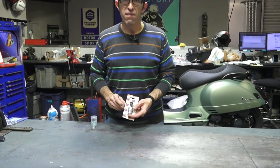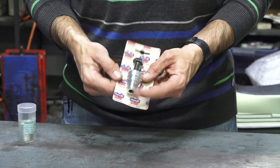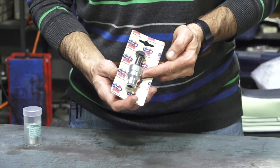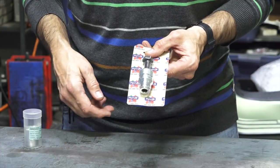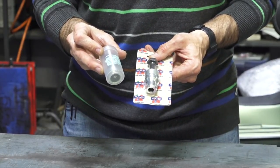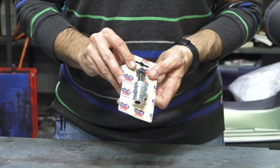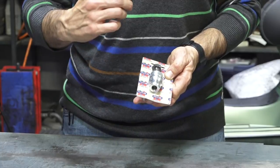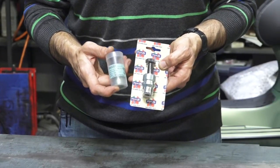This is a quintessential tool if you need to remove the flywheel to gain access to the points on a P series Vespa. Pretty much any Vespa manufactured after 1978 would use this style puller — that includes the ET3 small frame, any of the P range Vespas. Part number is Tool Fly. Sometimes if you're dealing with a scooter from India, there's also a unique flywheel puller, Tool Fly 27, that pulls off some of the Indian flywheels. Scooters prior to the 70s usually use a circlip to pop the flywheel off, which is a lot trickier than these standard tools.